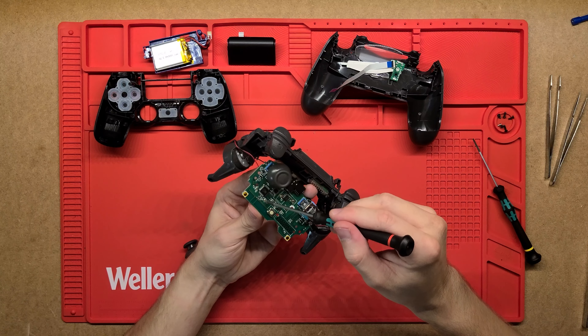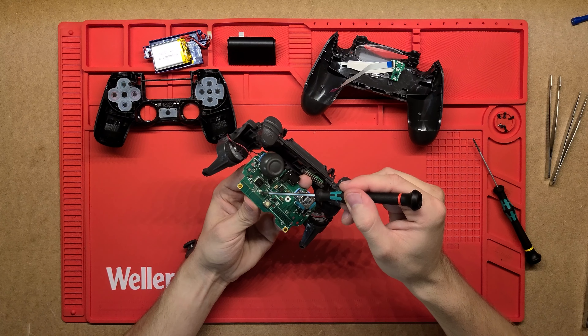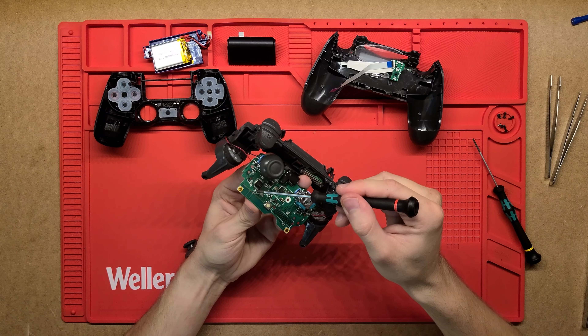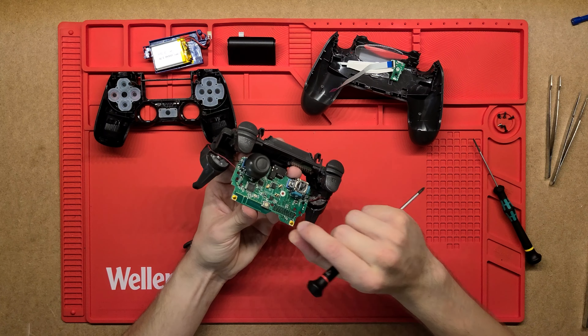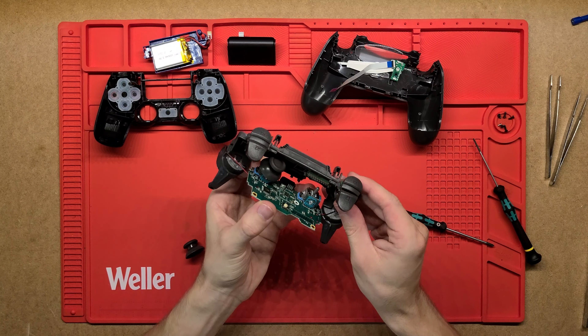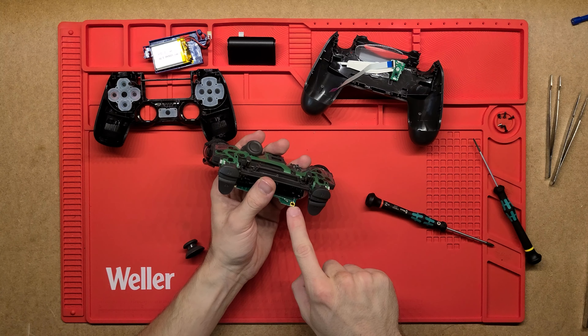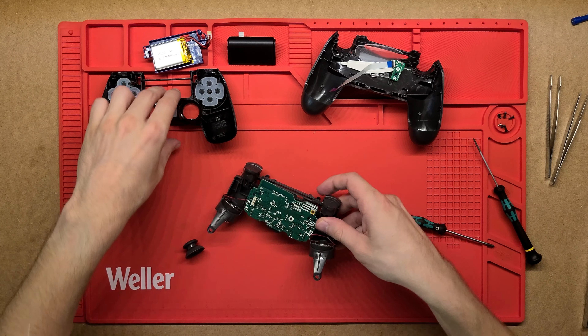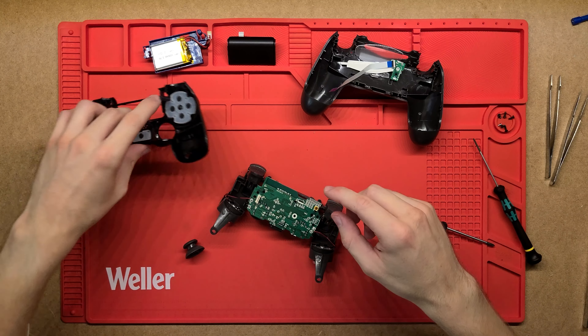On this side there are a lot of traces and quite a few exposed contacts, which can be used for programming the board. The PCB can be made with all components soldered on, and then a little external circuit makes contact with all this and programs the controllers on board — or it's used for troubleshooting and testing what different parts are outputting.